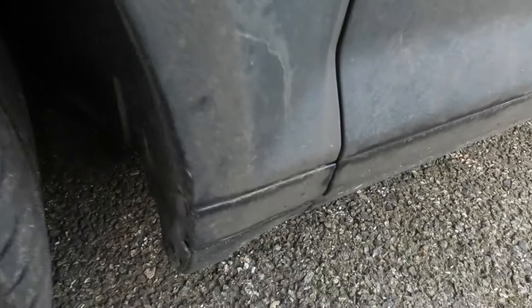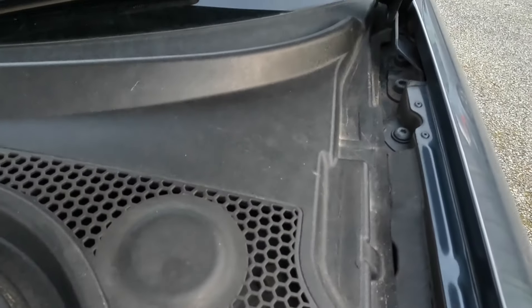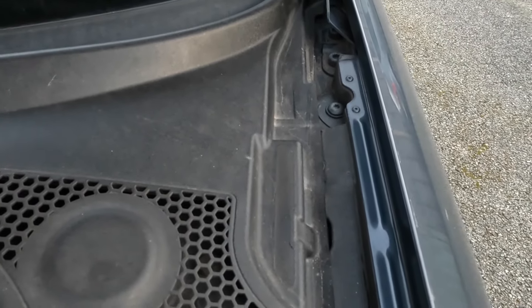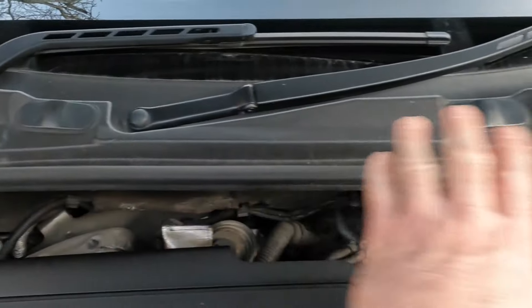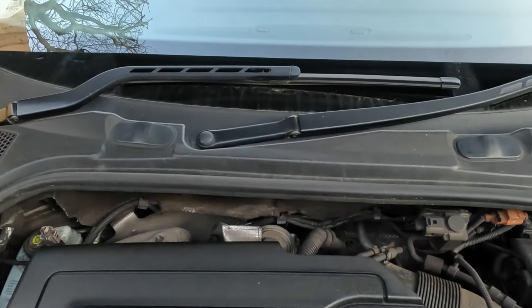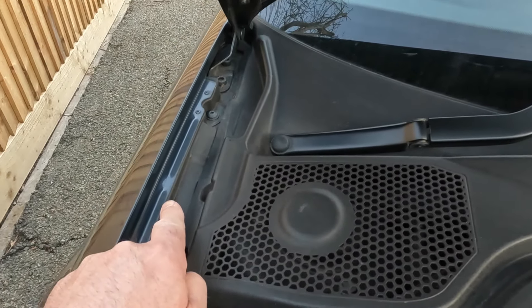The mud has been cleaned out from this area. The only downside of vehicles that have plenum chamber drains right at the ends here is that the water, leaves and debris do go down into the wings, so that is quite a common problem. Many other cars have a grommet at the base of the plenum chamber — usually a couple of them — and they can block up and allow this whole area to fill with water, potentially getting into the heater and causing a water leak into the car. That is not a problem on A3s and Golfs because the water drains out here into the wings at the back, so it is important that from time to time this is cleaned out. Thank you very much for watching — goodbye.